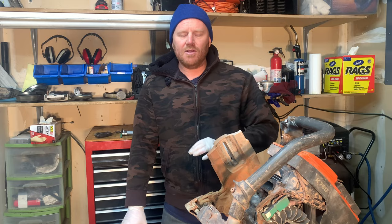As you can see, within just a few minutes I can quickly diagnose if this is even worth working on. With any two-stroke motor — cut-off saws, chainsaws, weed eaters — if you're working on them and they're hard to start, you want to check the piston, the rings, and the cylinder, because if they're heavily scored, it's not going to run right, and you're just going to be troubleshooting forever.